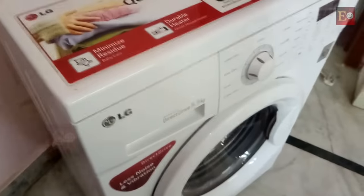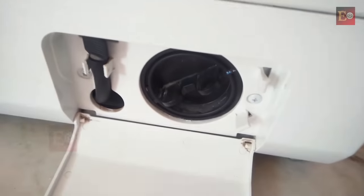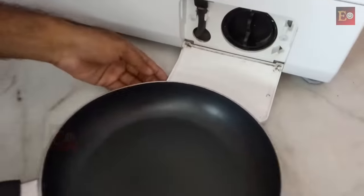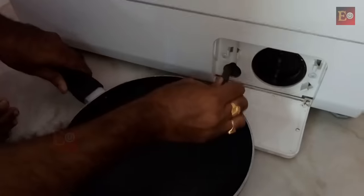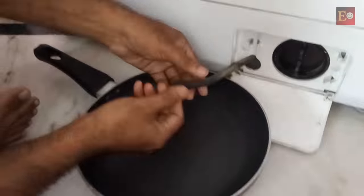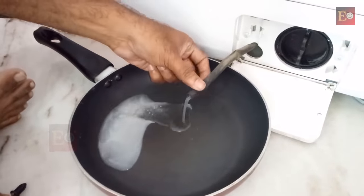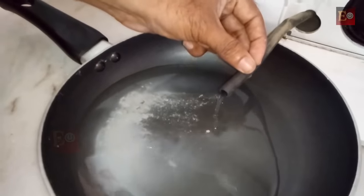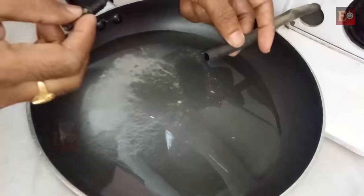If we go to the downside corner of the washing machine, it has a small door. If you forgot any coins, or if shirt buttons come off from the clothes, they will come here inside. Some waste water also comes with them here inside. We have to take a bowl or any tray. There is a small pipe here — if we open this pipe cap, the waste water will come out from this pipe. Water has drained; now we have to close this pipe.